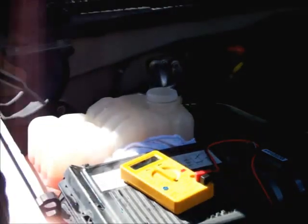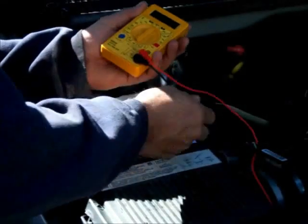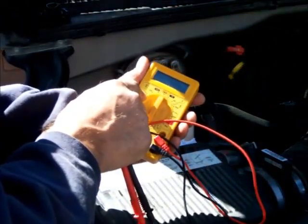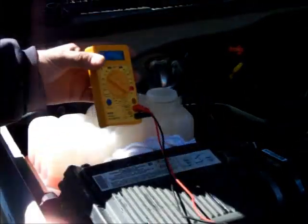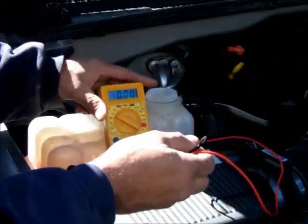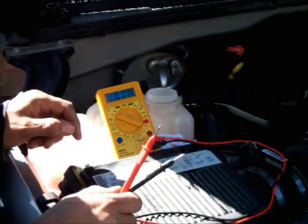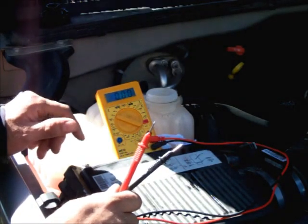But there's another test you can do, which you really should do, especially if you're running the red antifreeze. You take a simple voltmeter and you're going to want to go over to the 20-volt DC scale. Now, a lot of people have different opinions on this, but to me it doesn't matter which lead you stick in, because you're just looking for the reading. You don't really care if it's a minus or a positive reading — you're just looking for the number.